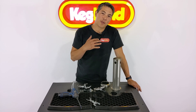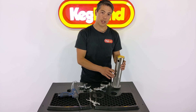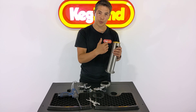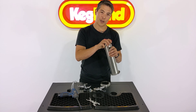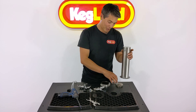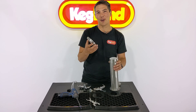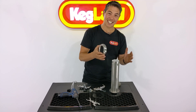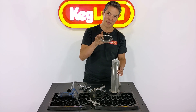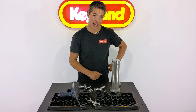We've got to the stage where we have to put the fonts together, or the towers, on top of the Kegerator. We've got various different tower options — the single, double, and triple tap tower is exactly the same. I'm just going to show you how to do a double. The first thing you want to do when you take this cap off the top of the font is put on this dust cap. A lot of people forget to put this on, get to the end of the installation, and go 'oh damn it' — they have to remove all the taps and start again. So first thing: put the dust cap on that covers the flange at the bottom of the font.